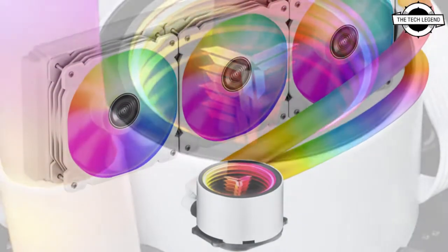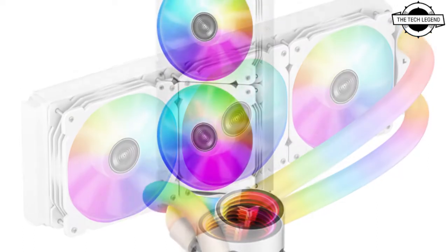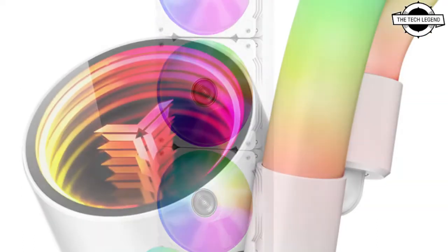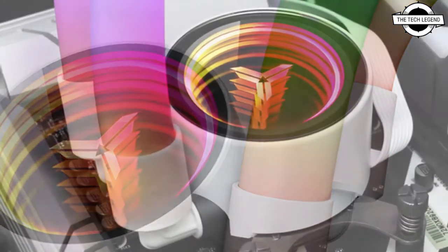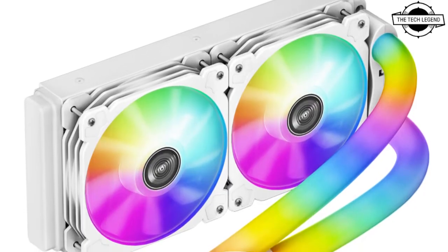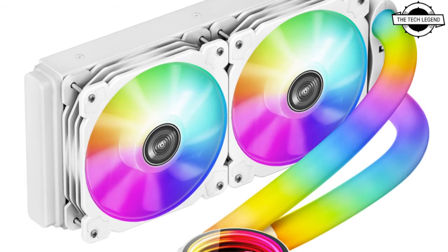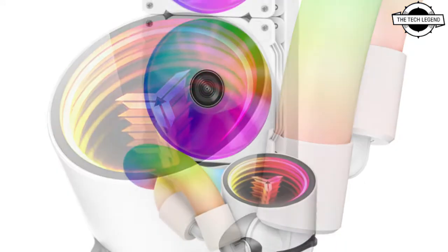The body is painted white and there are two different radiator sizes to choose from: 240mm and 360mm. The illumination of the water block portion is completed with an infinity mirror, and the heat receiving base is entirely composed of copper with a microfin structure consisting of 19 fins, 12 channels, and collated fins included in the radiator design.